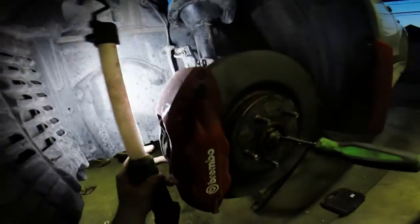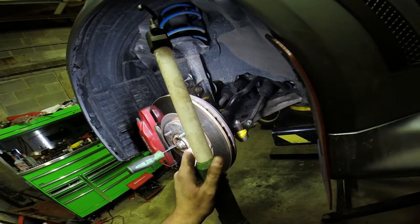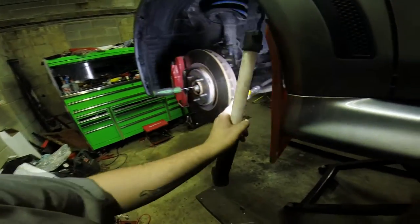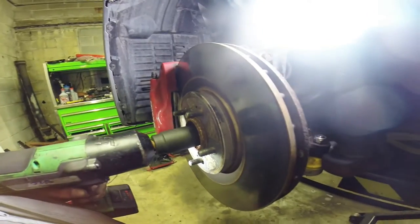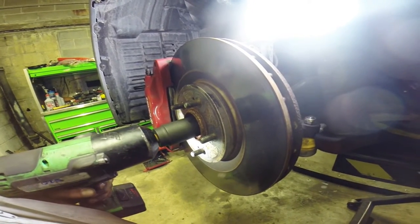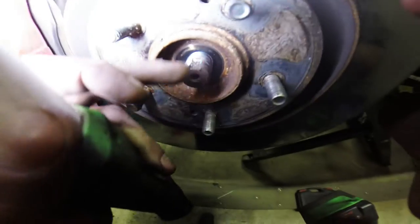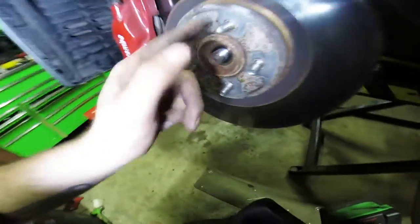We'll use the bolts in the back here and free everything up, move this off, take the rotors off so it's a lot easier and lighter for me to work with. Then we'll undo the top two bolts for the strut and the bottom bolt, and this whole thing — the bearing assembly — will slide out and hang. This is actually a 32 socket, so we're going to burp that off. The trick is to never stop halfway — just run it out. The nut is now stuck in that groove so we're going to clean that out first. It threads back on and we'll tap it back down when we're done.